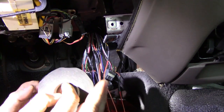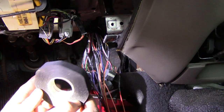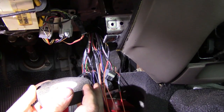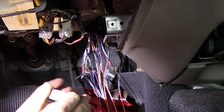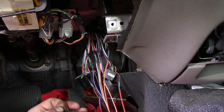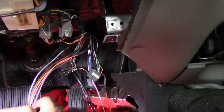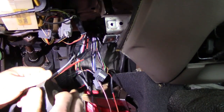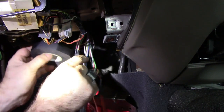I've got this cloth tape - Coroplast, made in Germany. Anyway, it's nicer than electrical tape, I like it better. I don't need to keep this from being electrified - everything is shielded and all that good stuff. We just want to kind of clean it up a little bit, it's a little bit messy. I'm putting a slack in this harness. We'll get to right here, stop this run, and connect it with another one.